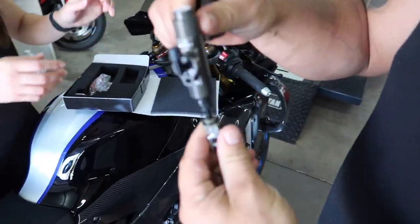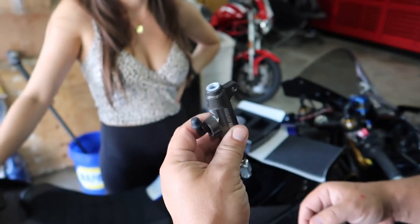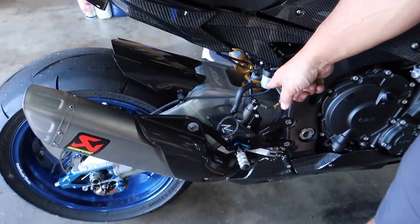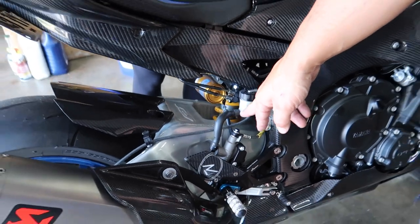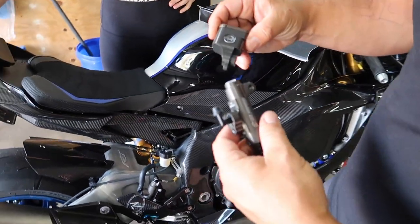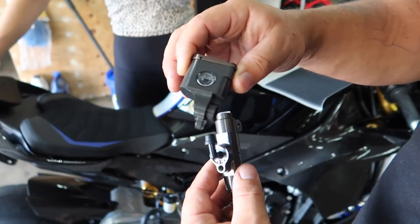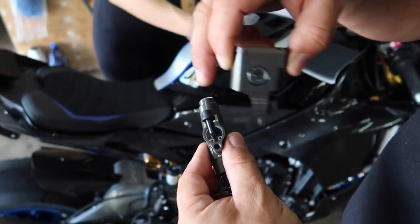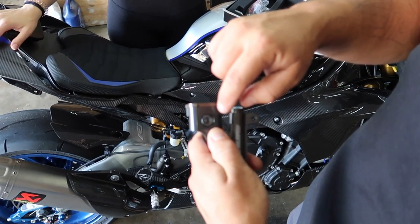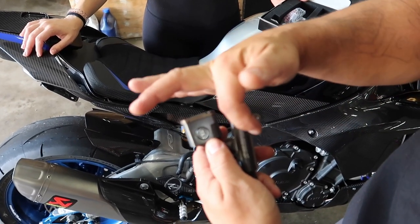This master is designed to mount in different angles and comes with different adapters. A couple of things to mention: when UV hits here, it breaks down your fluid a lot faster, and these rubber components will also crack, break down, and get brittle. With this unit, you can use it with a hose, or if you buy this additional unit, it connects right to the rear brake master with an O-ring. This eliminates UV damage and any components between here and here that might deteriorate over time.